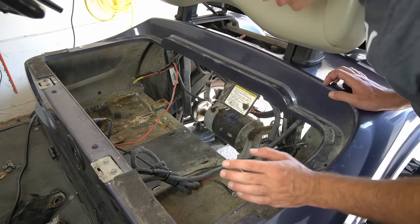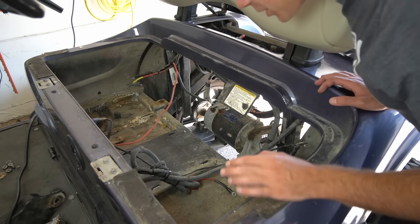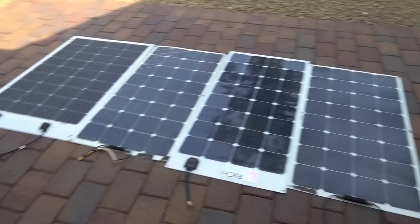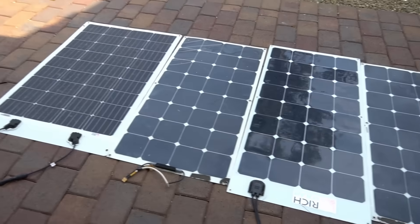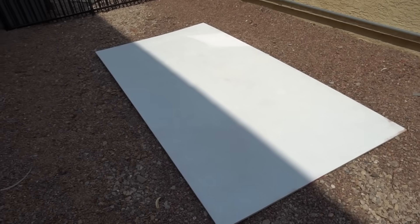It's very simple. If you're trying to build your first electric vehicle, this is probably the easiest way to do it — just swap the battery for a lithium and you're set. Here are the four solar panels we're going to put on the roof of the golf cart. I need four 100-watt panels to create a voltage high enough to charge a 48-volt nominal battery bank. This is what we're going to mount the solar panels on — just mount them with screws and slap it on the golf cart.